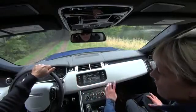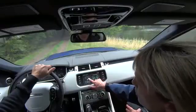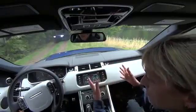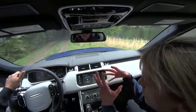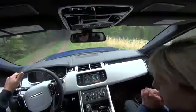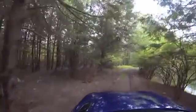I like this mode because it lets us see where our tires are as we turn the wheel. From our nav screen, go into extra features and it'll take you to the 4x4 mode. Here you can actually see the front wheels turn as you steer. Particularly out here in mud rut situations, you want your tires to be straight. We can also see our center differential and rear differential — as we get into more serious terrain it'll start to lock up, changing colors. We're already in mud and low gear.